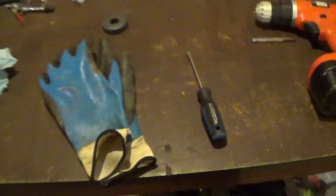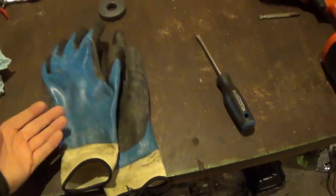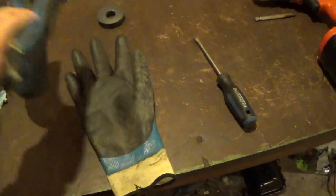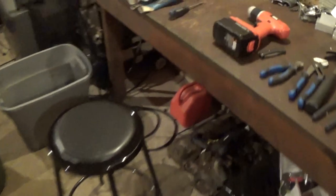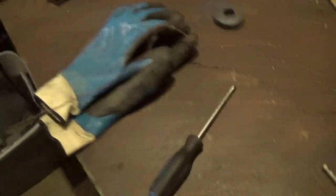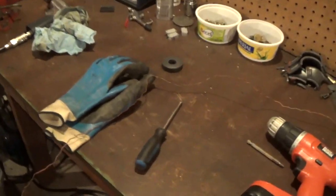What you're going to need is a pair of rubber gloves. You don't necessarily need them, but good PPE just to stay safe. A flat head screwdriver. A lot of people like getting the little alligator clamps, but just an old piece of wire will work. We're just going to tie that to the screwdriver and then we're going to ground the other side out to the TV.